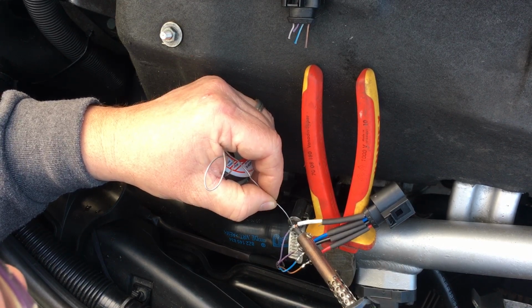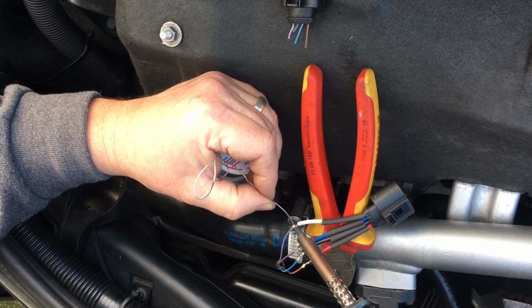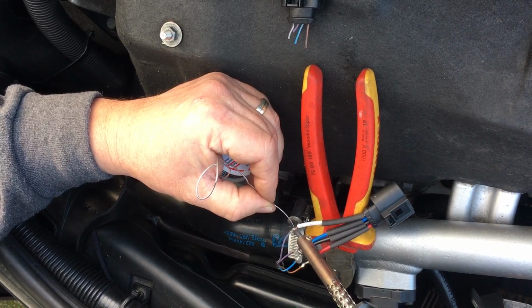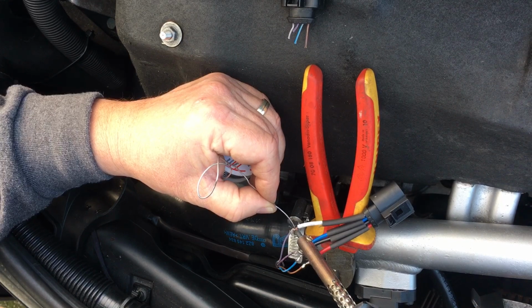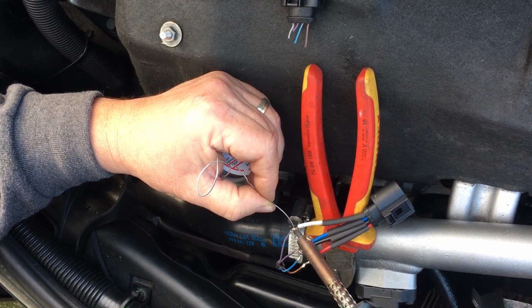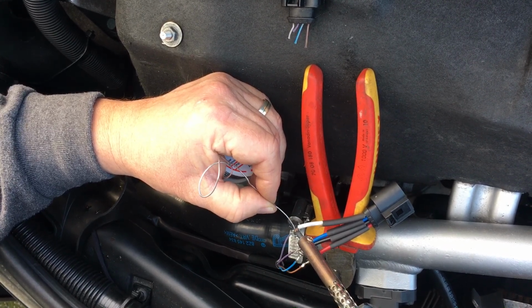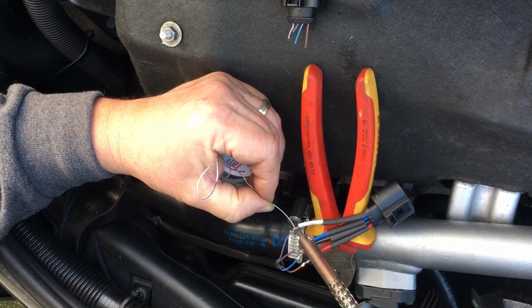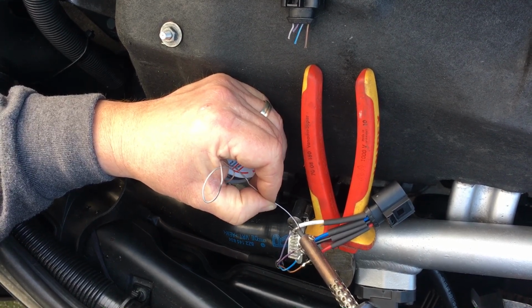So the car went into limp mode, and I plugged the diagnostic into it, and it came up with, I think, G71, so open or short to ground. And the little purple cable that forms part of it, I'd actually got a break in the cable just short of the plug. So I managed to trace it out on a dark and windy night, and today's been the first day it's been dry. So I ordered all the stuff up from eBay to be able to do what I consider to be a reasonable repair. It's better than some of the backstreet monkeys that I've seen. Although I could have done with a bit bigger soldering iron, although we are getting in there slowly.